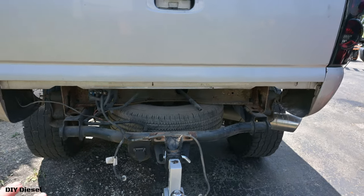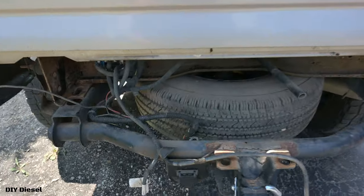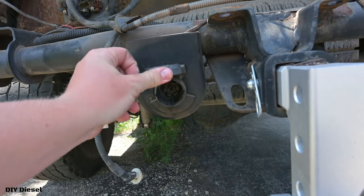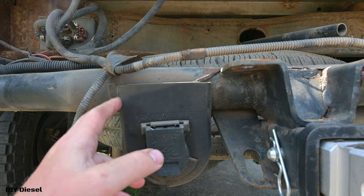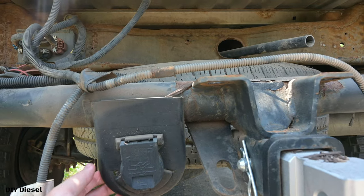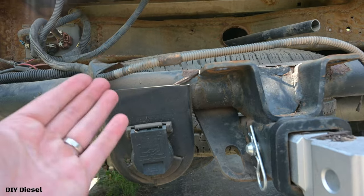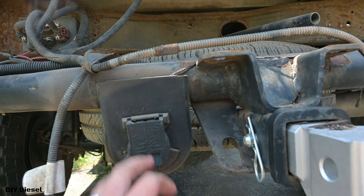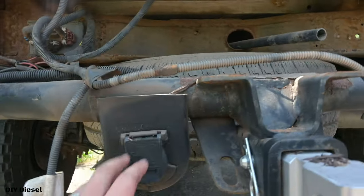If you've been following me you understand why this truck doesn't have a bumper on it — watch the previous video for that. But I'll show you right now: this is how your factory trailer harness plug looks. As you can see, it's bolted or welded onto the factory receiver. You can cut it off, leave it on, or put the seven pin in its place — that's what the twist-in version is for. I personally just like to put it up at the bumper.